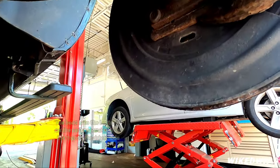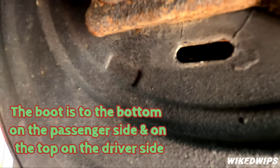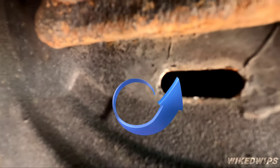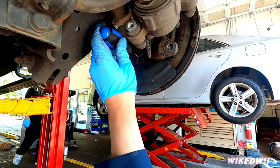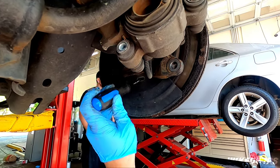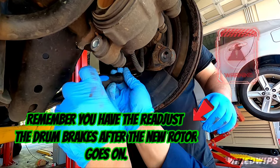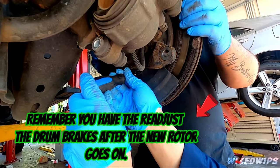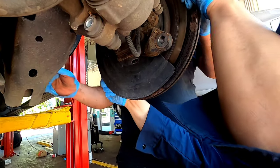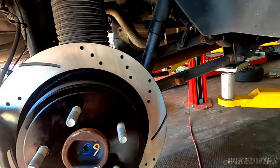Here's the anomaly — we have to take the boot out to access the little star cog in there for the e-brake. What happened is the drum actually made a lip on the inside of the rotor and now it won't come out. As long as he adjusts it and compresses the drum, they can pull it out. There you go.